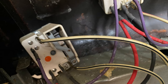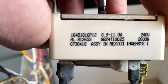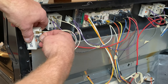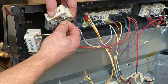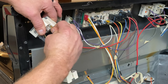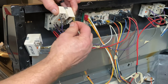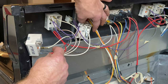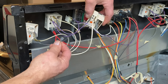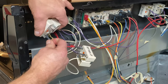Here's the wiring setup of the range switch, and I have the part number here — it's in the upper left-hand corner. All I need to do now is unplug each wire one at a time, which makes it easier to remember where the wires came from and where they need to go. I also have a picture I took. I take one wire off and replace it on the new range switch, which I picked up online at a reasonable price.